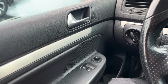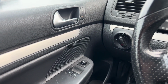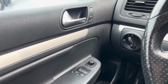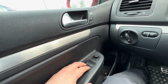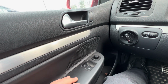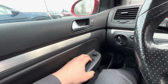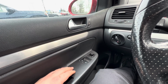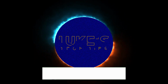is working. If it doesn't start to roll up on its own, simply roll the window all the way up and repeat the steps. This does need to be repeated for each window, so you can do it all from the driver window switch. This car only has 2, but if you had 4, you'd have to repeat it 4 times. And just like that, you've set basic settings on your windows.